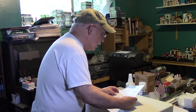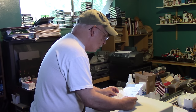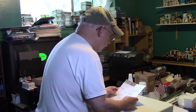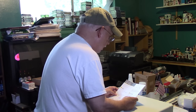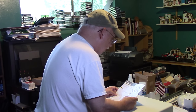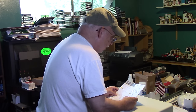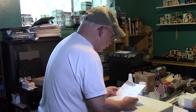Next, connect the power cord to the back of the product and to an electrical outlet. Caution, do not connect to your computer yet. You can set up your product to print and scan wirelessly from your mobile device or computer using the EPSON Smart Panel application. To use the app, see Setup from a mobile device on the back of this sheet. If you do not want to use the app for setup, then go to the next section.